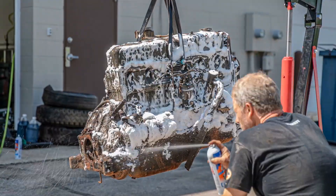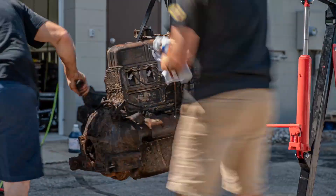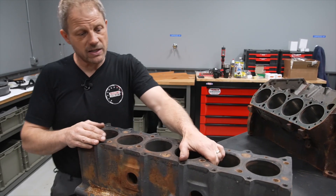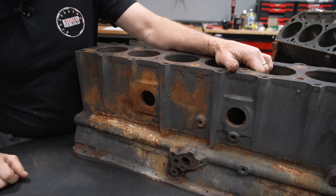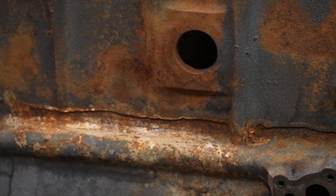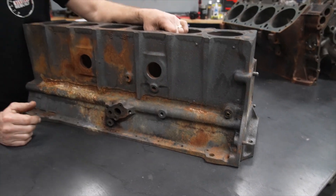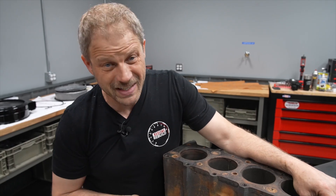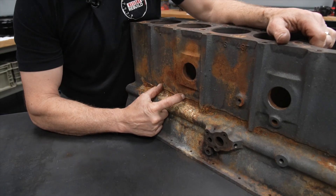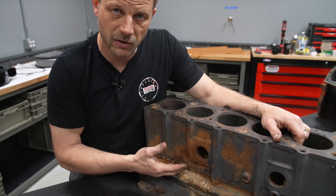I like to start off with a pure and simple visual inspection. If your block is dirty and greasy and nasty, a can of brake clean or carburetor clean goes a long way for visual inspection. For instance, this engine block on visual inspection has a really big problem — water was left in here, it froze, and it has a crack from one end all the way to the other. Just because it has a crack doesn't mean it's garbage. In this case it does because it's so long, but a shorter crack would be something to review with the machine shop, as there are repair techniques to cure that problem.